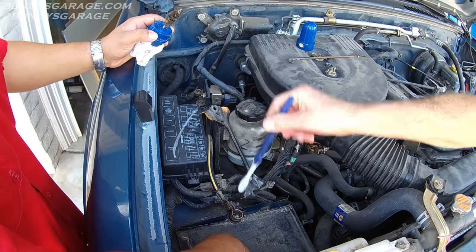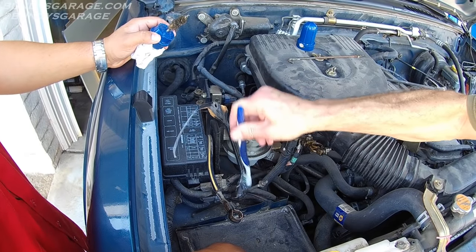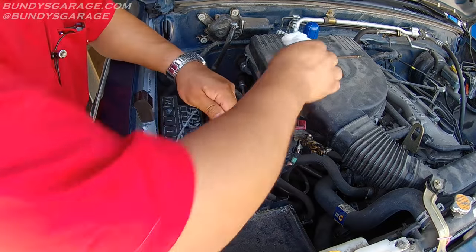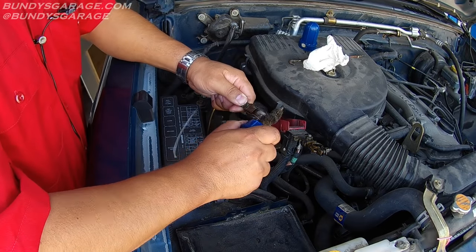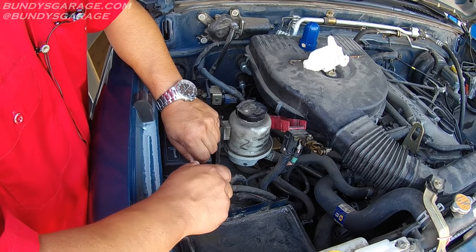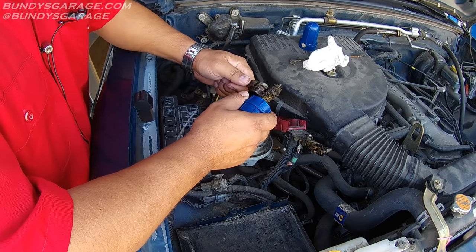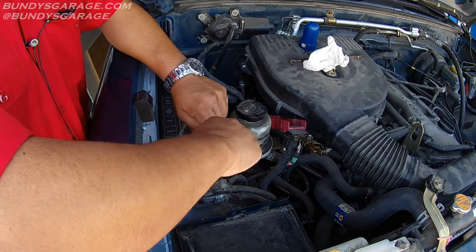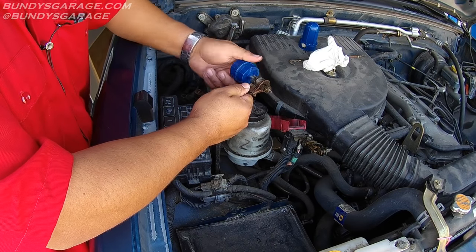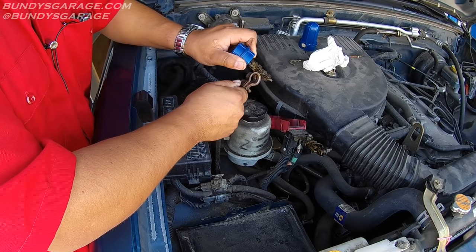It's also a good idea if you have corrosion on your battery tray — if you can take it out, wash it off, and do the same thing we did on the battery: 50-50 water and baking soda, clean it up. I've seen them so bad where I actually had to pull one out and spray paint it black. I just got stabbed with the metal tree, so you might want to wear some gloves. Auto parts stores sell a spray coating you can put on the terminals which is supposed to stop oxygen from getting to them so you don't experience corrosion, but they really don't work. The owner told me this car actually had it and as you can see it didn't stop corrosion from happening — one could call that a gimmick.